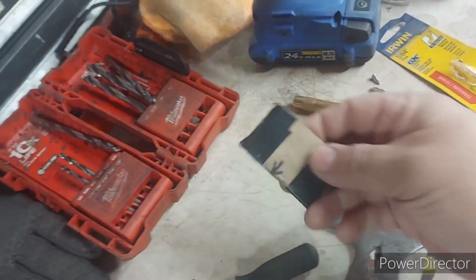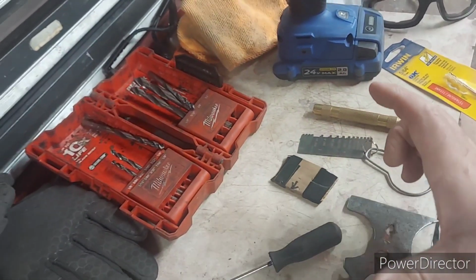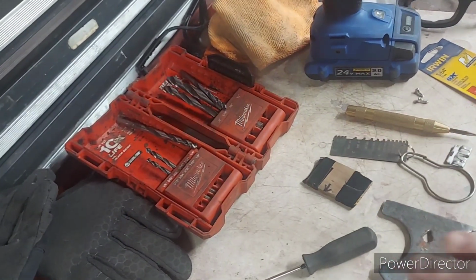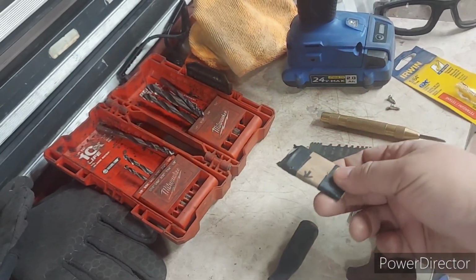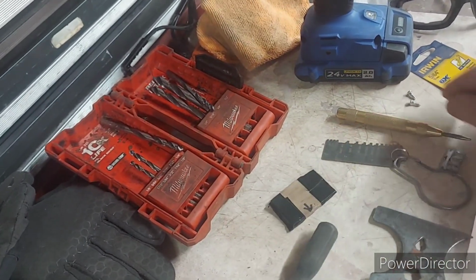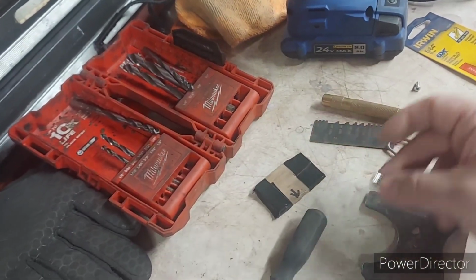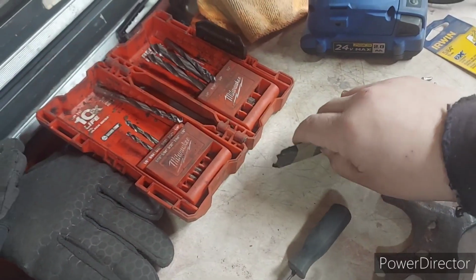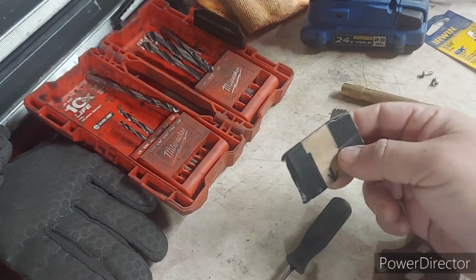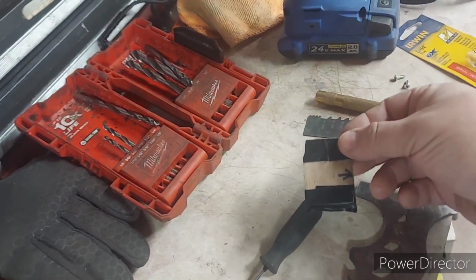And this shim here, I made it out of wood. This happens to be those packs that they sell you to shim things that are not stable, not even, so you could shim it. So what I did was I took the one that gave me a measurement, the thickness of the height where the original molding studs are welded on a first gen Firebird. And when I was happy with it, I kept it and I drew an arrow on it. This helped me with my 69 Firebird installation for the rear window molding.